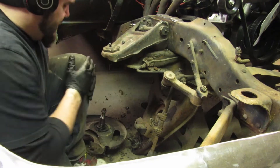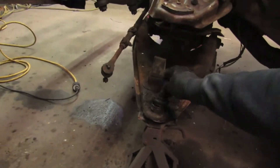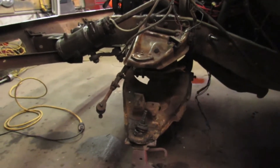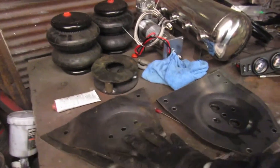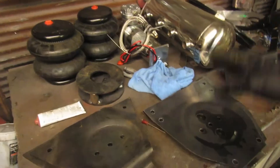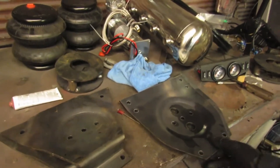I'm strong, I'm a man, I'm tough. It doesn't hurt real bad. As you can tell, I got everything off over there. I got new ball joints coming — these are shot, look how bad they are. I got new ball joints coming but I'm going to go ahead and get the bag stuff all done. That way I can at least bolt the spindles back on and move it around. I got to cut a bracket off the A-arms and drill some holes and put some bolts in them. Then I can start fitting my bags to see where I'm at — if it's too low I can add a spacer, if it's not low enough I can make a couple notches. But I got to cut some shit out first.